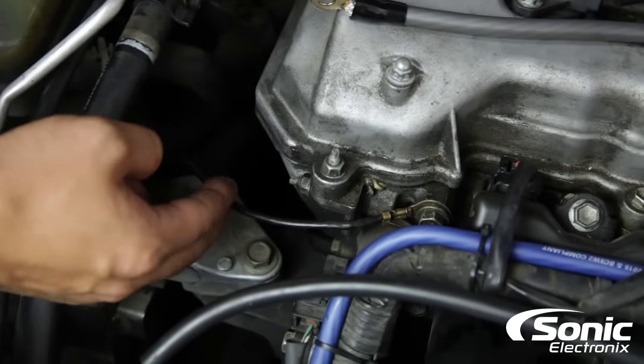Here's a 2013 Chevy Cruze. Obviously the battery is right there, and you can follow the factory negative terminal down to the factory ground. It's kind of hard to find exactly where the factory engine block ground goes from the engine block to the chassis. Way down there, really hard to see, is the factory alternator. This would probably be one of those cars where to access that charging wire to go from the alternator to the battery, you may have to put it on jack stands or get it up on a lift. This car may be a little bit more difficult in certain areas than others.